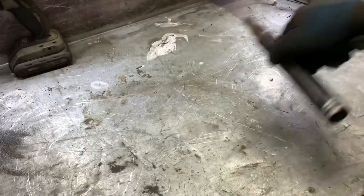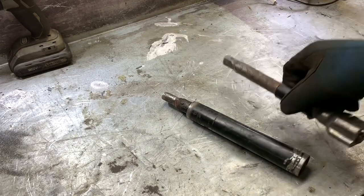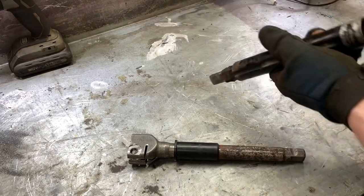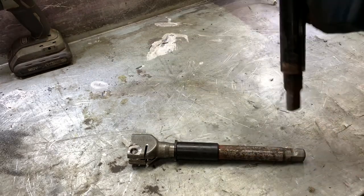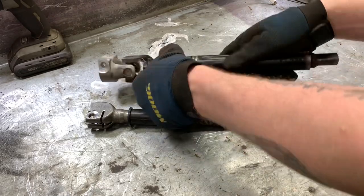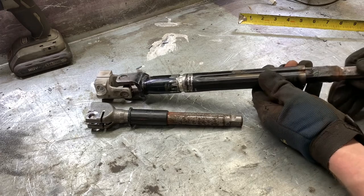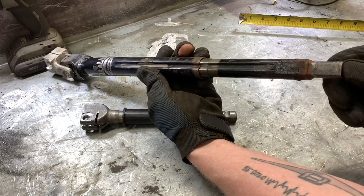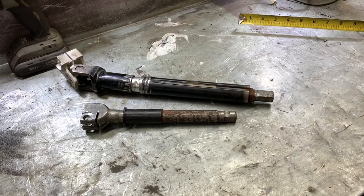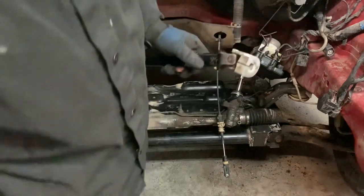Okay, all of our parts are here. Here's the steering shaft that I cut off with the end that I cut about six inches off of. Here's our original Dodge steering shaft. So if we lay this one out here, I also cut off this bushing because it was a bit too long. We put all this together — that can be shorter there. In reality we're five inches longer, so we do have a little bit of in and out room. I would like to have it so this doesn't collapse at all because that way we'll use the factory van slip yoke.